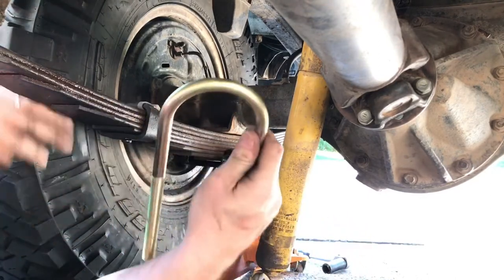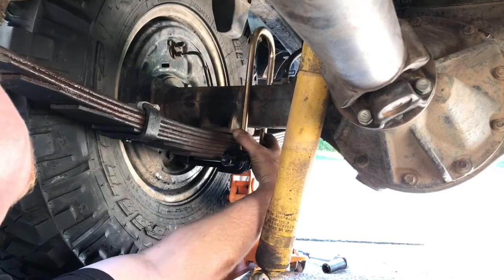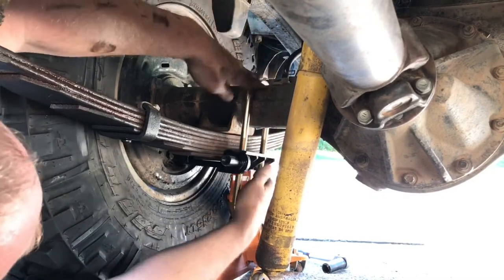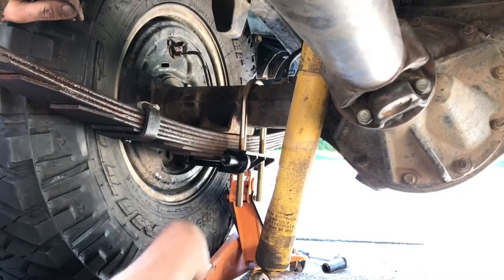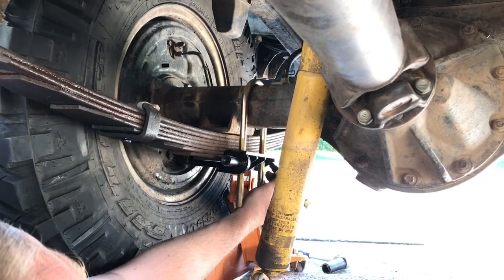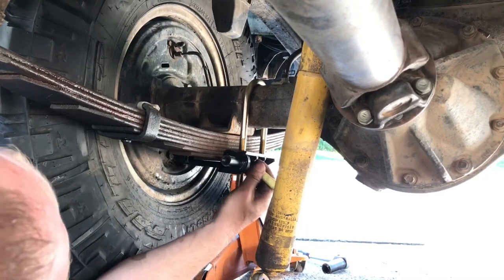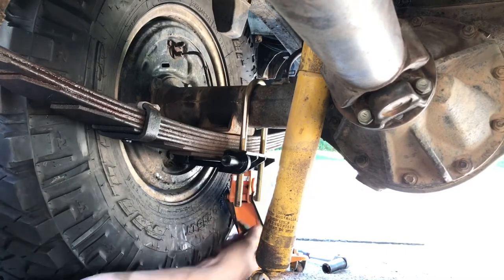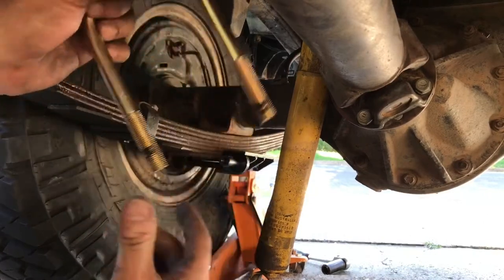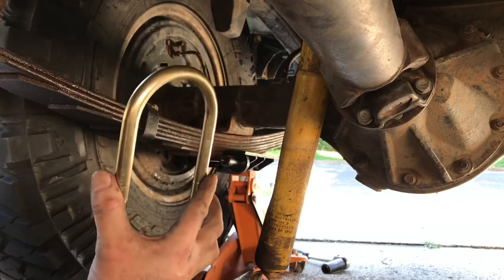So that's roughly on. The u-bolts are universal so I'm just going to chuck them in to get a rough idea of just how long they need to be, because obviously being universal they fit many things. I'll give that a mark and add enough room for the nut as well, then I'll trim those up. Back in a sec - cut them, took about seven or eight centimeters off. So we'll just fit those in and tighten it all up.